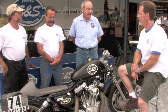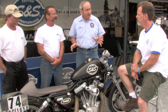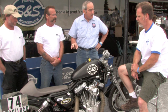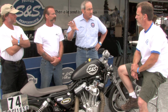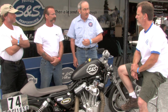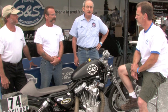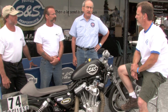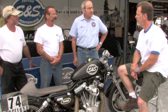It's not by accident that that happens. We did significant dynamometer work, we did significant drag race testing at Union Grove, Wisconsin. I was able to calculate based on that what speed I thought it would go and select gearing for this. However the bike surprised us — as we went down a tooth in the back, it kept going. Every time we made a run, we qualified, came back, got a record. We were lucky enough to do that three times in a row and get to the 170 mark, which was about a full five miles an hour faster than I really thought it would go. I thought it was going to be a 165, and I would have said I don't think 170, but I bet if we had another couple of tries, we might add a mile or two on that.